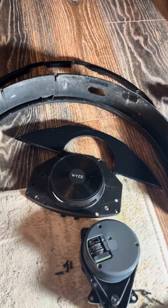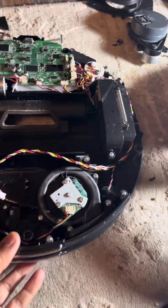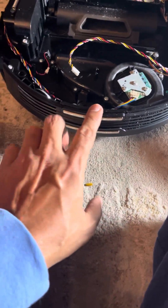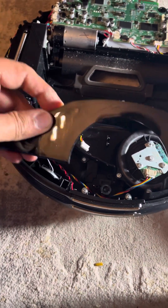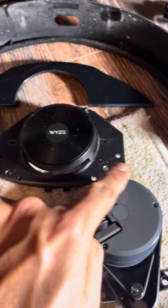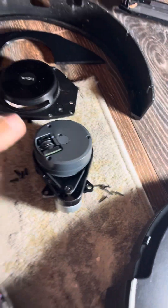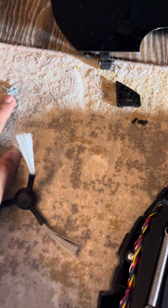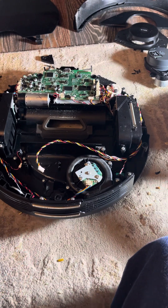The bumper removes this small piece — it hinges on one hook so you can take it off. When you turn it around, there's another big task. This is the front end where the lidar sensor exists. You have to pry this top piece off with a screwdriver, then remove two screws here, plus four to six more screws total. Then remove four or five screws on top — basically whatever screw you see, remove it. This plate hinges and requires another six screws to get off.